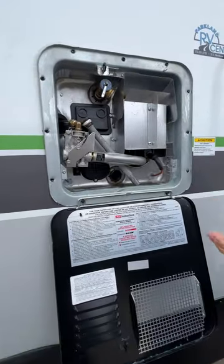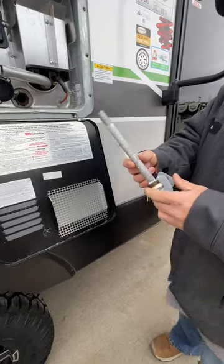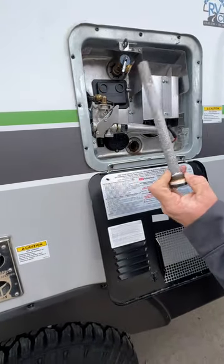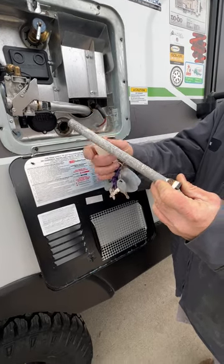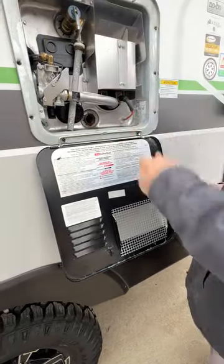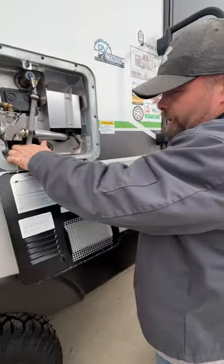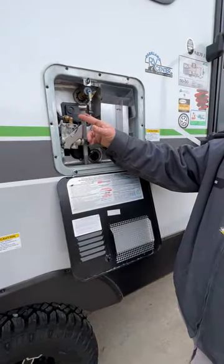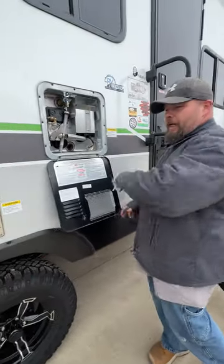This guy here is the front of the water heater. You've got your anode rod here — as you can see, it's already a little worn from factory testing. What it does is it attracts the impurities in the water, so it attacks the rod and not the tank, because the tank is steel. You always want to periodically check this — as it dwindles down, when it gets about halfway, it can potentially fall off, so try to replace it. It starts out the size of a dime and works itself down to the size of a coat hanger. This water heater has gas and electric options. The gas is controlled from inside. The electric option is the switch down below — make sure there's water inside before hitting that switch or you can burn up the element. To remove the anode rod, you'll need a 1 and 1/16 socket. You always want to take that rod out and get all the water out of the camper so it doesn't go bad.